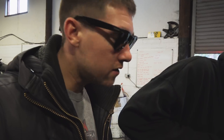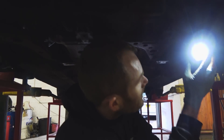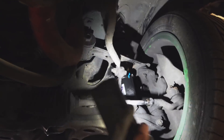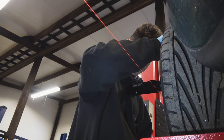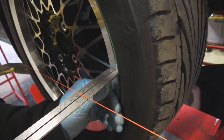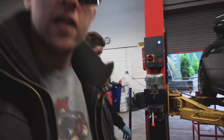That's now equal toe — Scousey is just trying to get one mil of toe-in on the back. Hopefully we should be nearly there. The stock toe on one of these was two mil; this car's obviously running stiffer suspension than it was designed for with the older soft suspension, so with the stiffer suspension Scousey is running one mil of toe-in at the back. Up front it's pretty much the same procedure for the camber — it's got the same eccentric bolts with the washer so we can adjust those, move the arm in and out. For toe you've got your normal steering rack track rod arm. So we're going to be adjusting the toe on that — we've got full adjustment on toe so we can have it wherever we want.